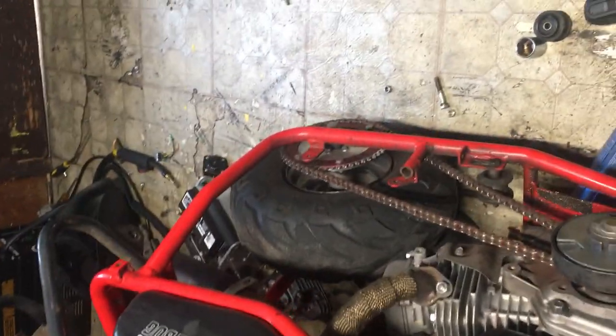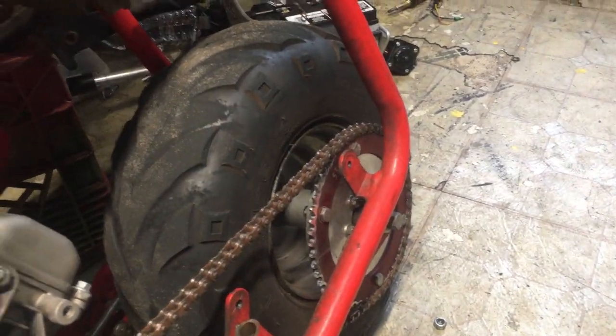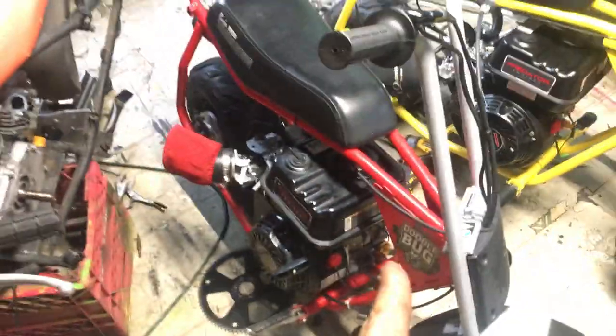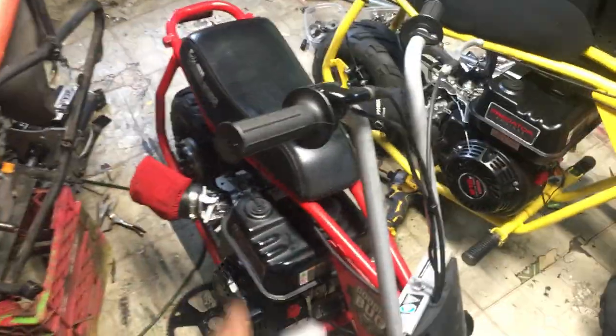Before I show you that — if I were to show you this bike — this bike has a billet split sprocket adapter with a smaller rear sprocket. This bike has a 72-tooth in the rear, which is bigger than that. So you, not knowing anything, you'd look at it and be like, this bike would pull more top end than that, right? Because the rear is smaller. Wrong. It's a different gear ratio.